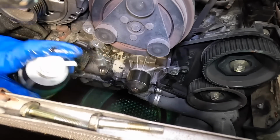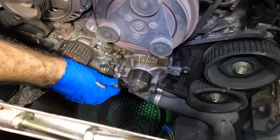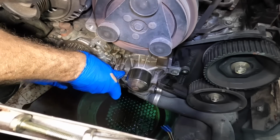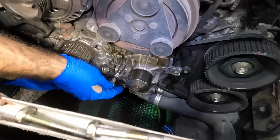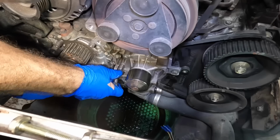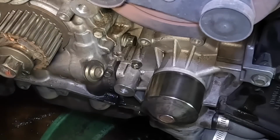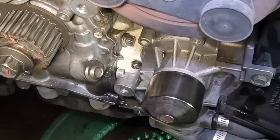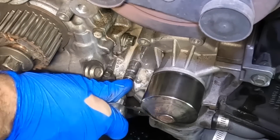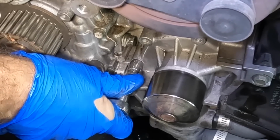Throw some more oil back there. Maybe those threads will soak it up. Okay, going in again. Dangerous moment. Let's tighten that bolt. Yeah, it's turning. It turns, but it likes to get locked up. Okay, let's loosen the bolt. Come on out of there, you. See, it turned a little bit, then it got stuck. Actually, get some more spray in there. Now we'll tighten it again, and hopefully tightening it will carry some of that lube into those threads, help break them loose, or break up some of that corrosion that's in there.